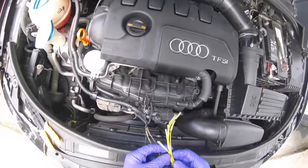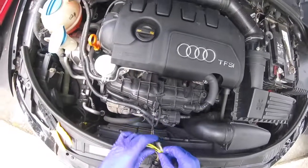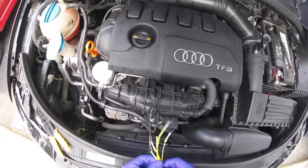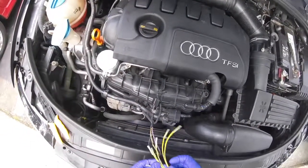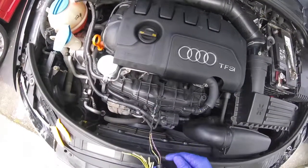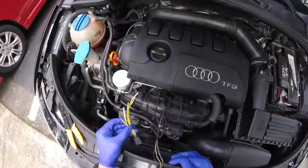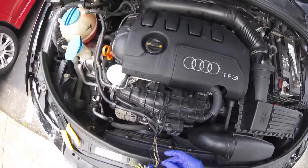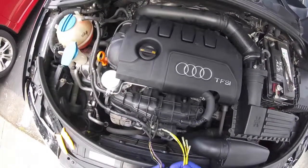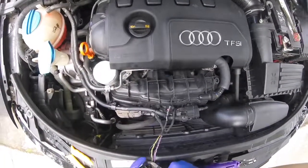Now if I lay these down, I have them each cut at different lengths — this is to prevent bunching up at one point. If they were all the same length, you'd have a big bulge right there, which we don't want. So these are all cut at different lengths per the TSB. I'm also going to twist them up so they match how they were originally. The all-yellow wires denote that an OEM fix was done, so I'm going to cut that off but leave enough to tell what color goes to what terminal. Going to the point of no return — I'm going to snip these.